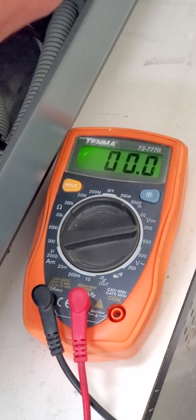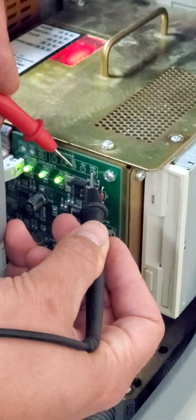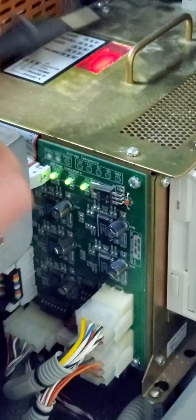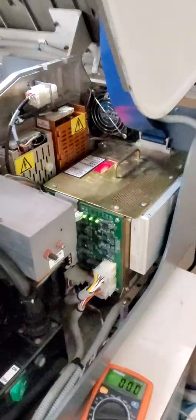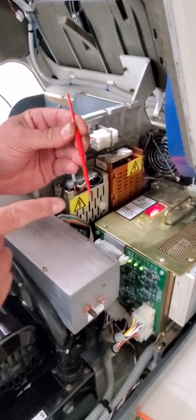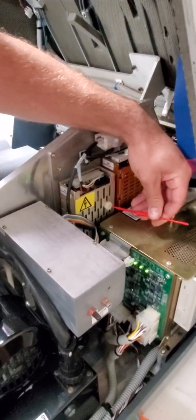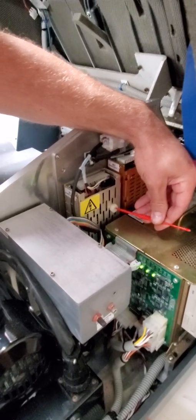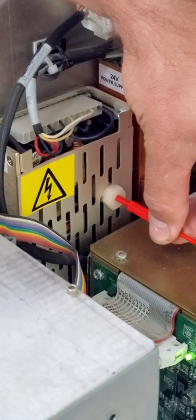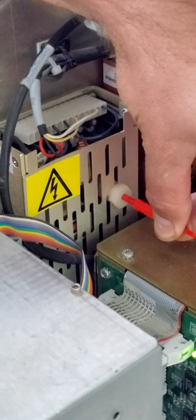So let's say you tested your 5 volt and it came in at about 4.6. On the 7E, the first power supply here is your 5 volt. You want to grab a screwdriver — preferably a plastic one like this one — that has a longer extension to reach the screw inside. Most of these will have a plastic nut with a hole in the center. Put it all the way in there and there will be a flathead inside. To increase voltage, turn it clockwise. To bring voltage down, go counterclockwise.